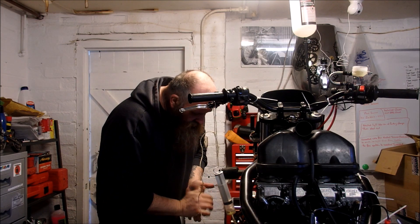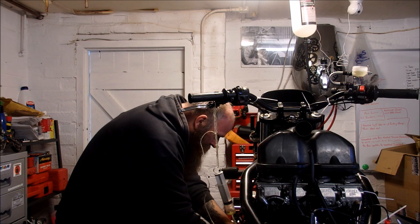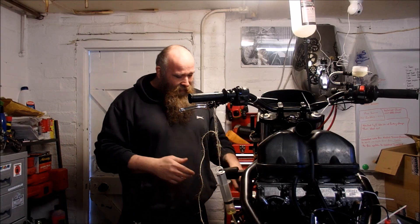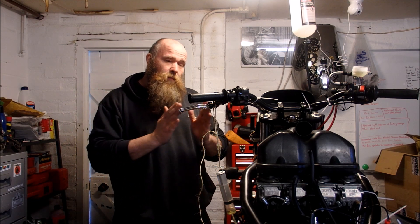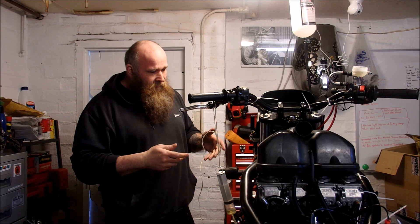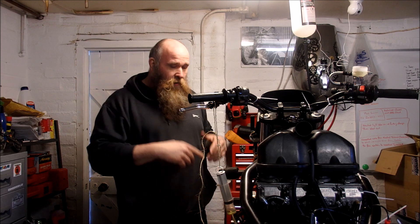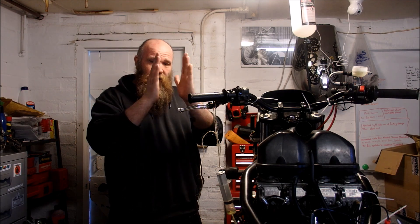We have air — a bubble just came up, that's interesting. We just had a great bubble come up through the system. The brakes now work. That caliper wasn't working well — I couldn't see visible movement and couldn't see the pot coming out to meet the brake. I took it off, banged it around, put it back on, pressed the brake, left it open and pumped it — and I've just seen air come out. Maybe I dislodged something.